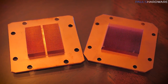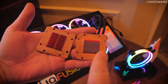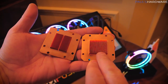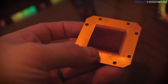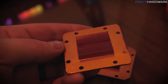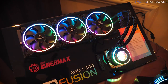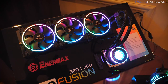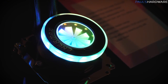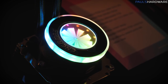They also have a little breakout here of their cold plates. This is their design on the left. As the liquid passes through the micro-channels in the cold plate, if you have a solid design, you're going to have more resistance for the liquid flowing over it as it gets further across. So they put a gap in the middle — it helps reduce resistance so the liquid can flow more freely and give you better cooling. The 360-millimeter version is $139.99 and is available now. It still has the little flow indicator that spins ever so gently as liquid flows through.